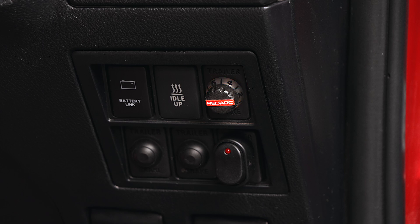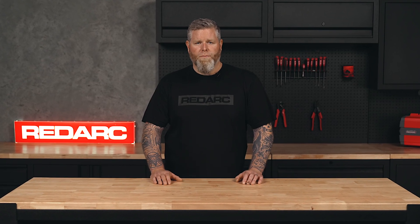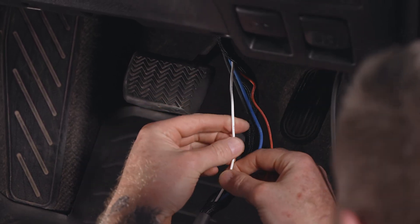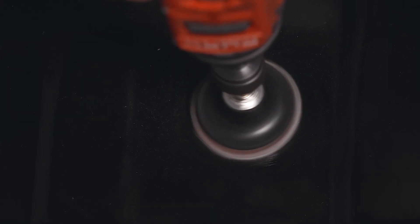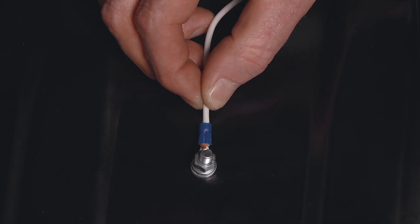If the remote head on your TowPro is yellow and flashes four times, it is indicating there is a poor connection or intermittent open circuit somewhere along the white ground wire. This poor connection could be caused by a painted surface, loose grounding bolt, bad eyelet crimp, or bad solder joint. To check this, trace the white wire from the main unit to locate the connection to the vehicle ground. Once this connection point is found, check that there is metal to metal contact between the vehicle ground and eyelet. If the connection is not metal to metal, remove some paint where the earth eyelet comes into contact with the vehicle body. Also, ensure that the eyelet is suitably crimped to the wire. Give the ground wire a slight tug — you should not be able to pull the crimp from the wire.